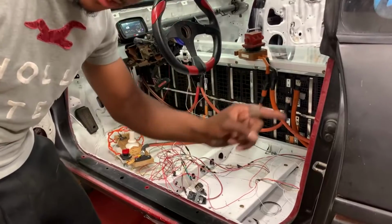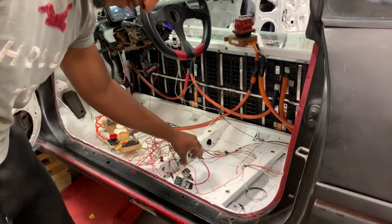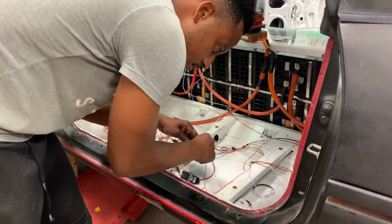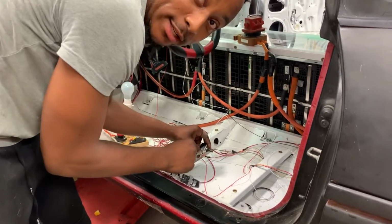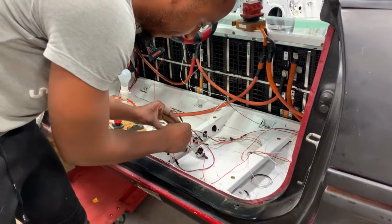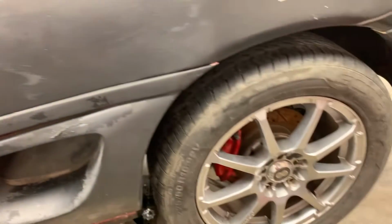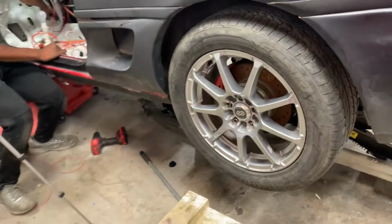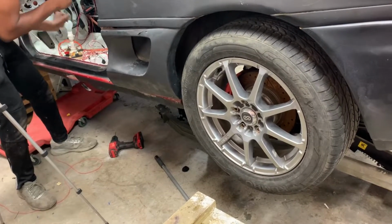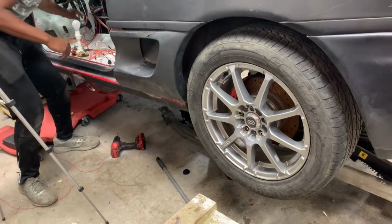The flash, that means that the capacitors inside of the Tesla unit are pre-charged. Now, oh, impressive. I heard it. That's the positive contactor. Now it's going to await a forward or reverse signal, which actually is already there. Wheels are up. Okay, hold on. Let's see. All right, we don't have any power just yet. That's fine.